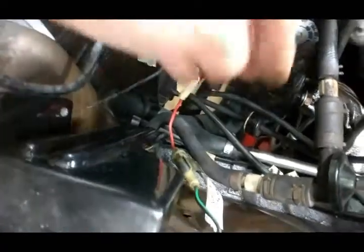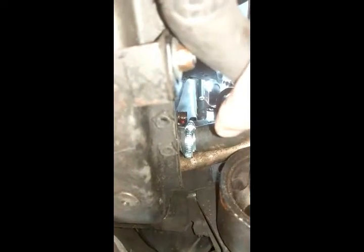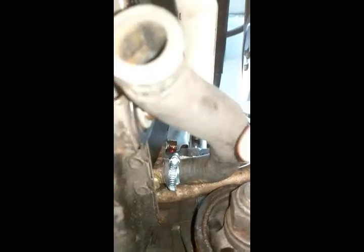I'm going to show you this little thing I did. The pipe that goes from the heater — the heater core return — there's a little pipe on the end. I changed it so the old one is a perfect fit under here for draining. There's a drain tap on the bottom of the radiator with a little rod that runs to the top of the rad, and you can drain the radiator without coming under here. I fitted the hose that used to go from the heater core back to the radiator onto there, and I just tuck it in there when not needed — then you can get it out and put it into a tub.